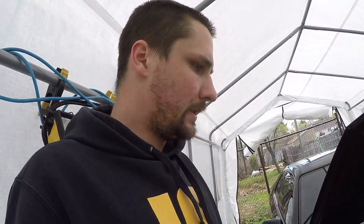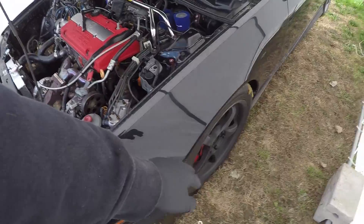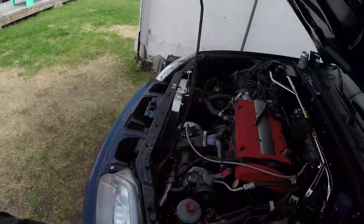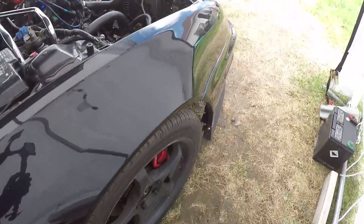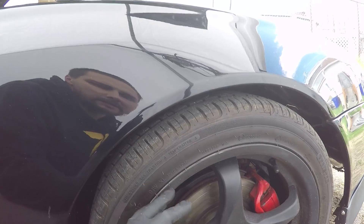Ultimately all the bolts that are hidden somewhere are gonna have to get removed, then we're gonna jack up the car. Once the car is jacked up, we'll be removing the tire on this side and on the other side as well. We're gonna remove the axles — the axles are gonna have to be clipped out from the transmission so we can pull out the transmission. It's gonna be a pain because a lot of it is rusted. This axle was replaced freshly last year so it should still be good, the other one's gonna be a pain I believe.